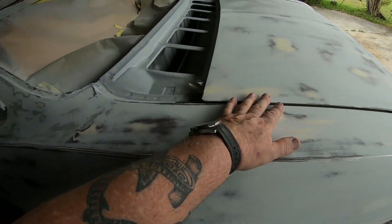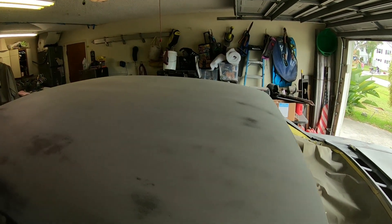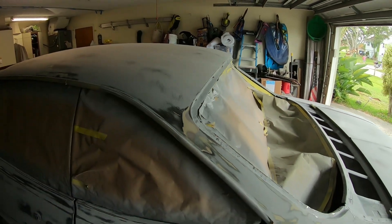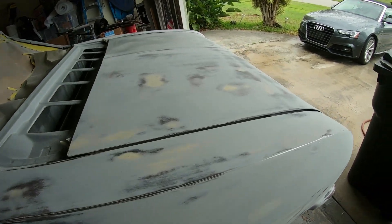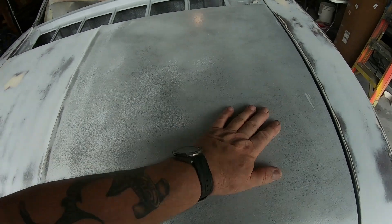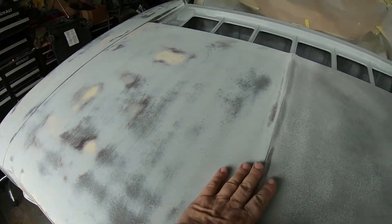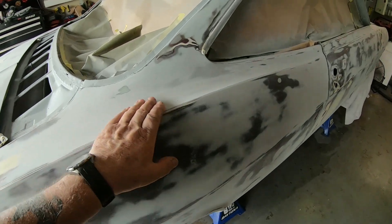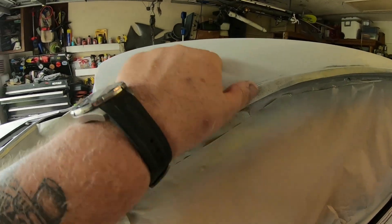I got to take care of that. This side of the trunk is done. The roof is pretty well done — there's some more blocking by hand up there. I did most of it by machine today, because the stuff was just too hard to sand off. I got it all down to level, and it's going to get another coat of primer, so it's going to have a nice even coat on. A couple spots in here I got to do, like over here I got to hit.